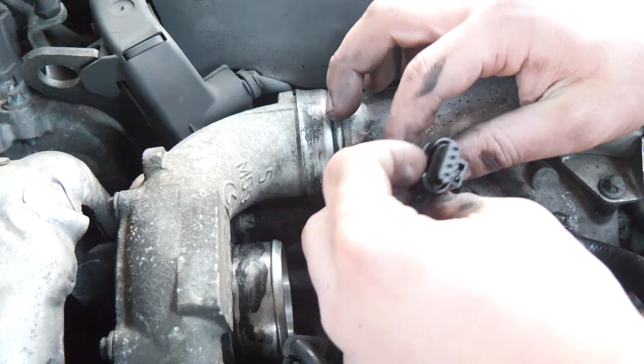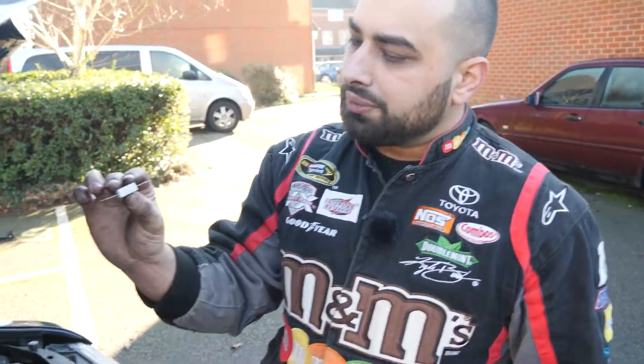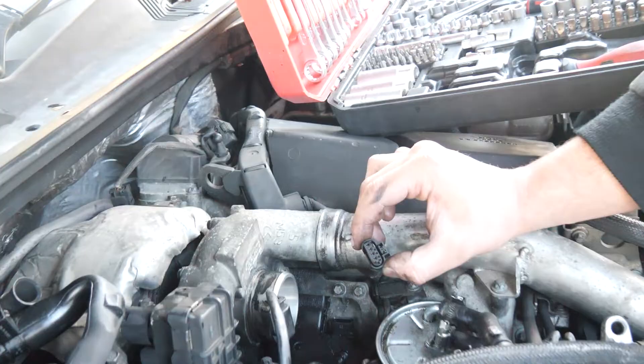To take this plug off, you can also remove the three bolts — one here, one here, and one here — these are 10mm, which you can remove for more convenience. In my case I don't think it's necessary, as you can see it came off easily. For the repair we're going to use a resistor which is 4.7k ohms, 5 watt. You can use anything between 2 and 5 watt.